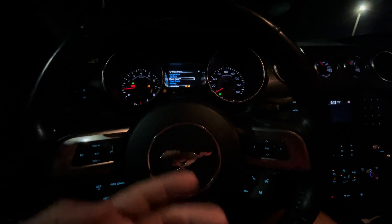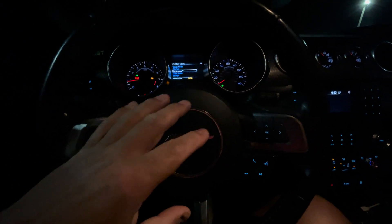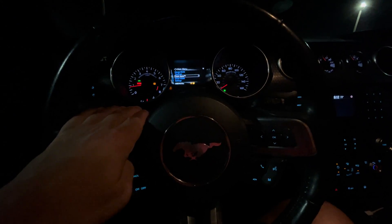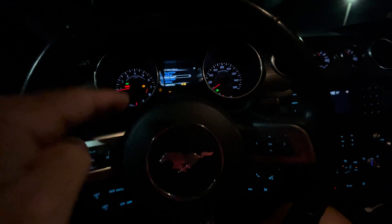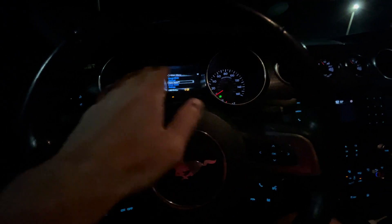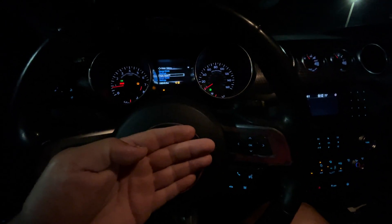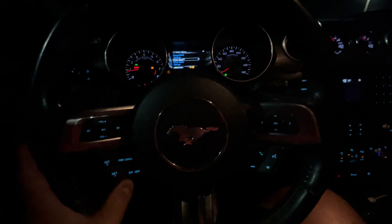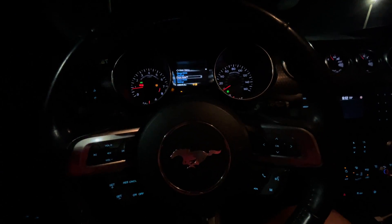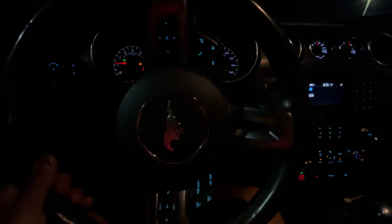So a rolling rev limiter - why would this be useful? Think of roll racing. A lot of us do roll racing events, and for example Texas 2K, the left-hand lane dictates the pace and they want you to be within 50 to 60 mile an hour. You can preset it - you have to previously set all this and know what mile an hour, what gear does what, so that you don't go past that mile an hour. You know the car is going to be exactly where you want it as long as you're holding the cruise control off button. The moment you let off of the cruise control off button, the car takes off and it doesn't have the rolling rev limiter.